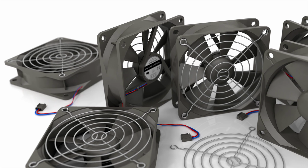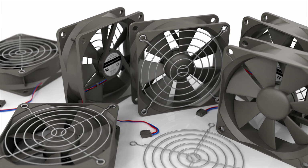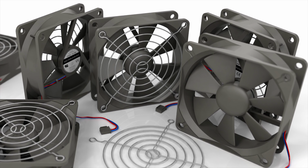Same goes for having enough fan controllers on your motherboard. I have 8 case fans in my case, but my motherboard only supported 6, so I had to get a 3-way fan splitter. So make sure that you keep all that type of stuff in mind when you are building your PC and ordering the parts. Overall, there could be very many small incompatibility issues, so make sure to consider those by really researching your parts and knowing them in and out.